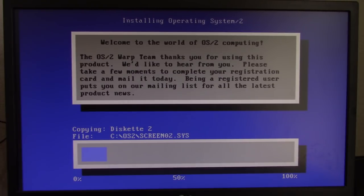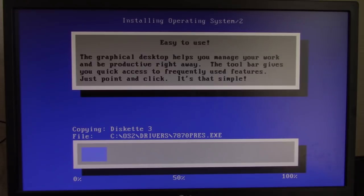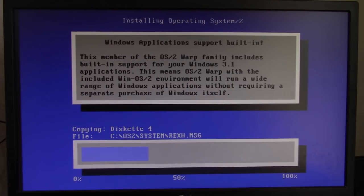It allowed greater file names, greater size file names. It broke the 8.3 DOS barrier for file names, allowing 255 character file names. And what else did it have? It had built-in features that fought fragmentation, that placed files close together. And what else did it do? It did a number of other things.